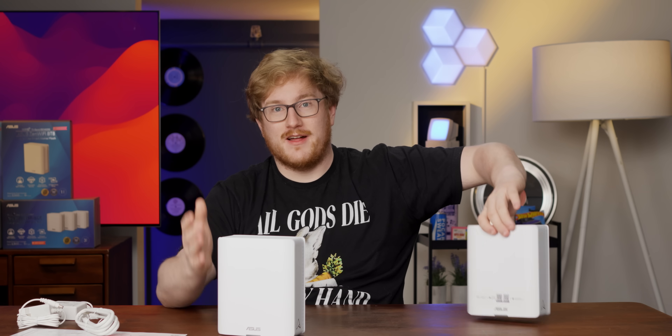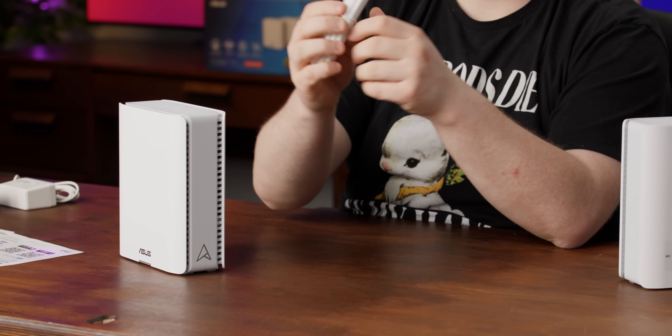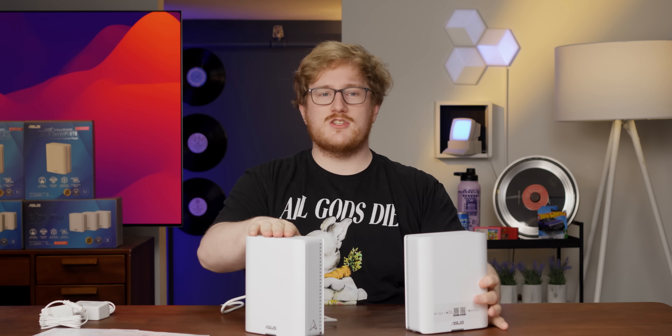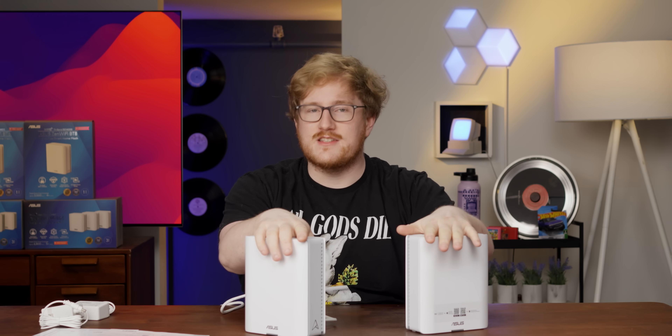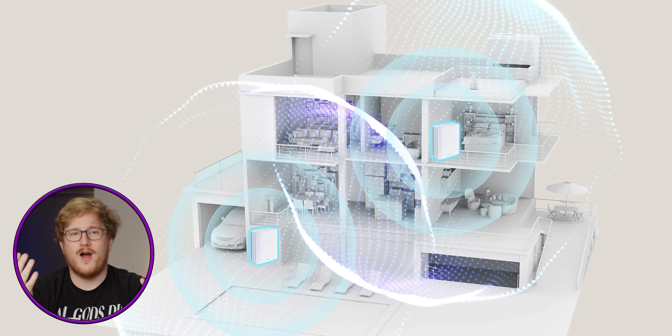For the uninitiated, if you're not familiar with Wi-Fi meshing — a lot of houses don't have hardwired internet, and even if they do, it's not always in the place where you need good Wi-Fi. You take your main box, plug it in at your ISP's fiber box, cable modem, or existing router. Then the second or third unit goes elsewhere in your house, apartment, or small business, and these two connect to each other wirelessly, making a really high-speed backhaul highway between each unit.